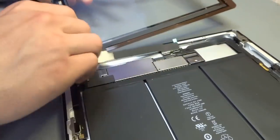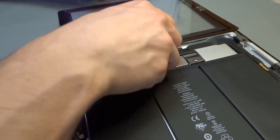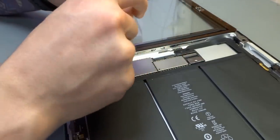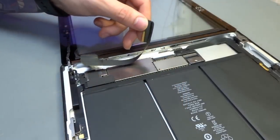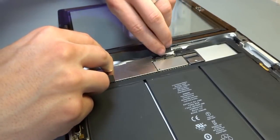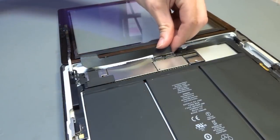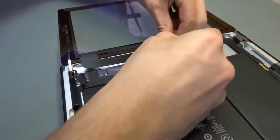It's almost like a little smile — two eyes in the silver and a little grey smiley face. That's really key. If you need to lift it and put it back down, do so. Now they're bound by the home button cable — no quick movements. Peel that off; there should be no blue plastic anywhere once you've installed it. We're going to slide these in — you see those two white lines? That pretty much tells you when those white lines are right on the edge of the actual connectors. You'll know they're in as far as they'll go.